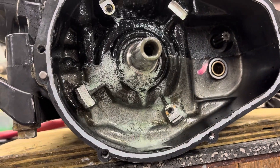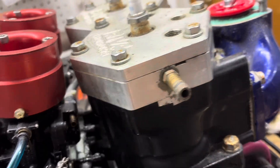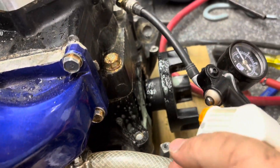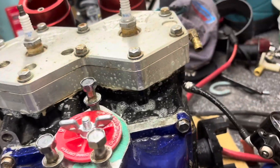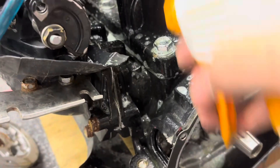So that's one leak we found, which means it's got to be split. But there can also be other leaks at the bottom of your jugs, around your carburetor or intake manifold. Your head can leak, your manifold or exhaust manifold. This whole case can leak anywhere — your rear crank seal. That one looks to be good. The jugs look good. So yeah, you can just walk around your whole motor and spray it, and if something bubbles up, that's a problem.